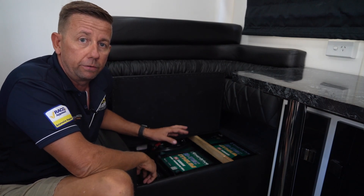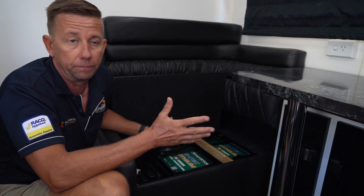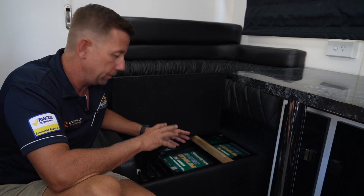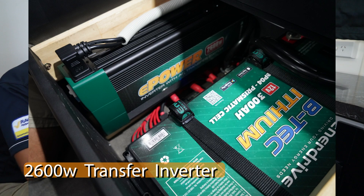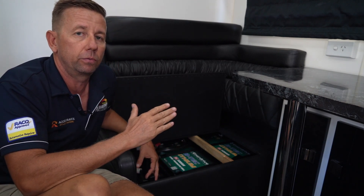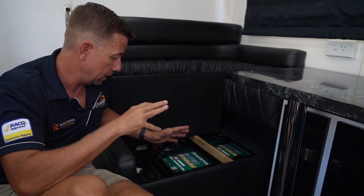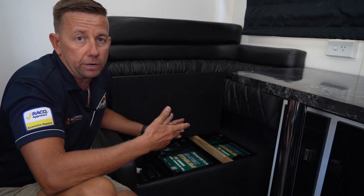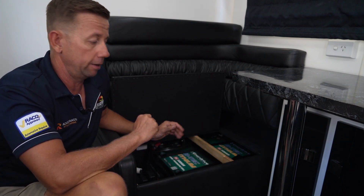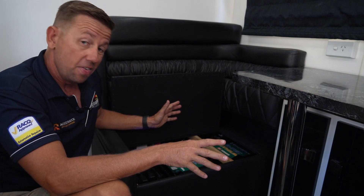The batteries are flowing into the Enerdrive 2600 transfer inverter. We use this inverter because it'll run everything — air conditioning, microwave, coffee machine, inductive cooktop. It's a fully integrated inverter: if we plug into a caravan park, it'll bypass through the transfer switch and the van will electrically run from the caravan park. The minute we disconnect, power seamlessly transitions over to the batteries. When plugged in, the battery charger kicks in; when running off batteries, the charger doesn't kick in. It's all automatic.